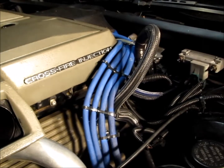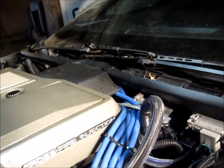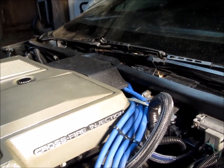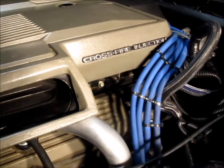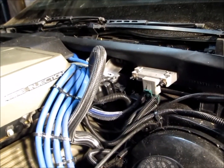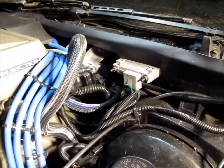Look at all your connectors. I took my ECM out from under the dash — I did end up putting a new electronic control module in the car, but I also cleaned up all the connectors and made sure they're really tight. Almost all the connectors on the car have been rebuilt. Make sure your battery terminals are really clean on this particular car, because that low voltage correction mode on the ECM causes a lot of problems. Just thought I'd share this — it's something to look at.